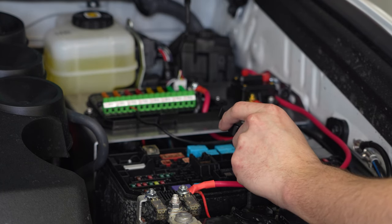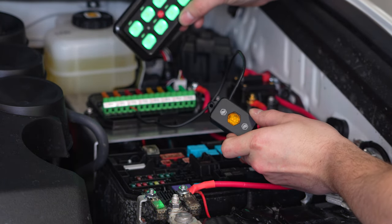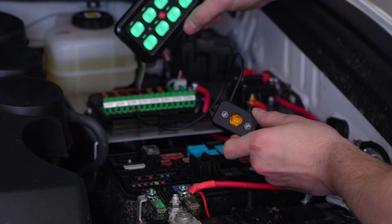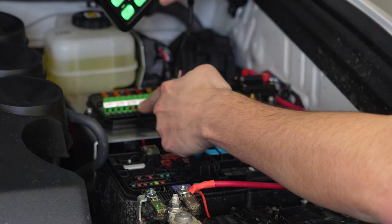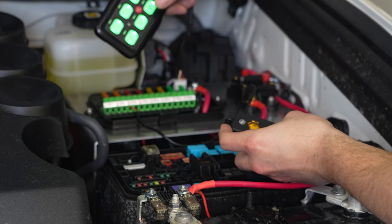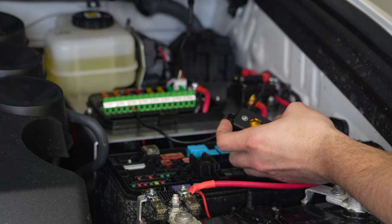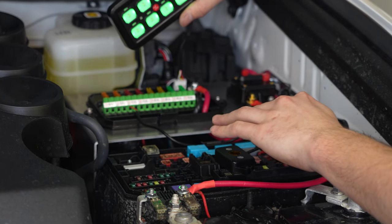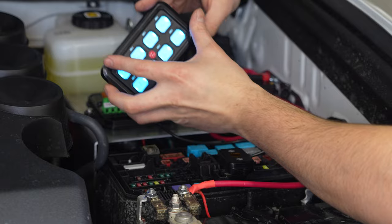It's the third slot in, so it's going to be this button — there it is. You can see here with this inside you can control your rock lights. If I were doing a full install I would wire all of my rock lights to this one 10 amp fuse — or whatever amperage you think it would require — and then turn all your rock lights on with one switch. That's the benefit of having a system like this — it makes for a pretty clean setup. Any extra wiring that you have you can just put underneath the tray and you really won't see it.